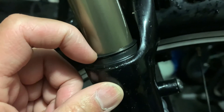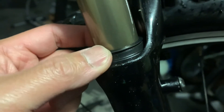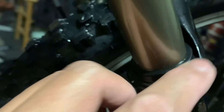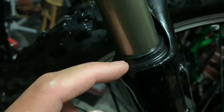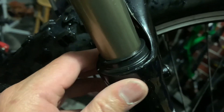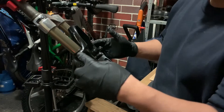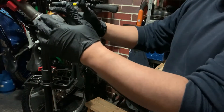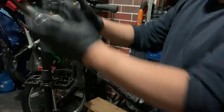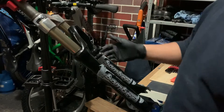This is the left suspension of the Marzocchi fork. The spring which grips the edge is also gone. On the other side you can still see the spring, so this is probably the already worn-out side. I'm going to use this opportunity to strip the whole Marzocchi fork apart and replace the oil and also the bushings if necessary. What I'm going to do first is give it a physical clean — this is what has been advised by experts online, to give the whole fork a clean before carrying out any maintenance or repair. We're going to spray isopropyl alcohol all around and wipe down.